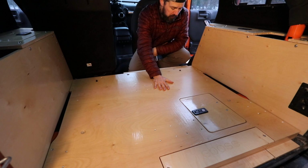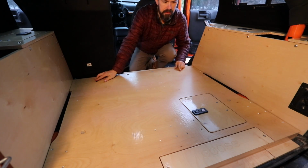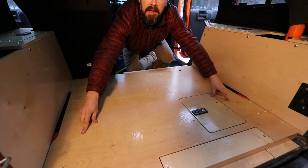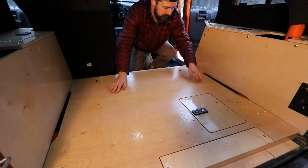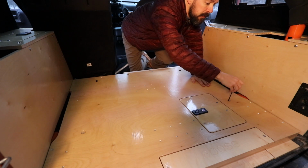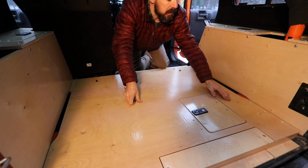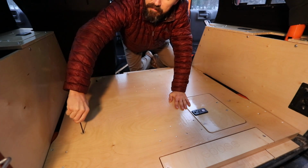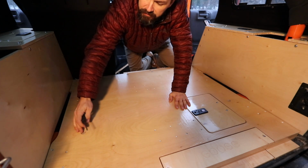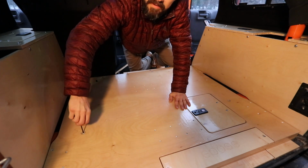The rear plate bolts down in 4 points very easily. Here, here, here, here, and it utilizes the same bolt holes that the footman loops use from the factory, so no drilling. However, my varnish went on too thick, so my holes are clogged up. I might have to drill the varnish out, but I'm just poking around with a screwdriver to see if I can avoid that. I think the screwdriver might work.